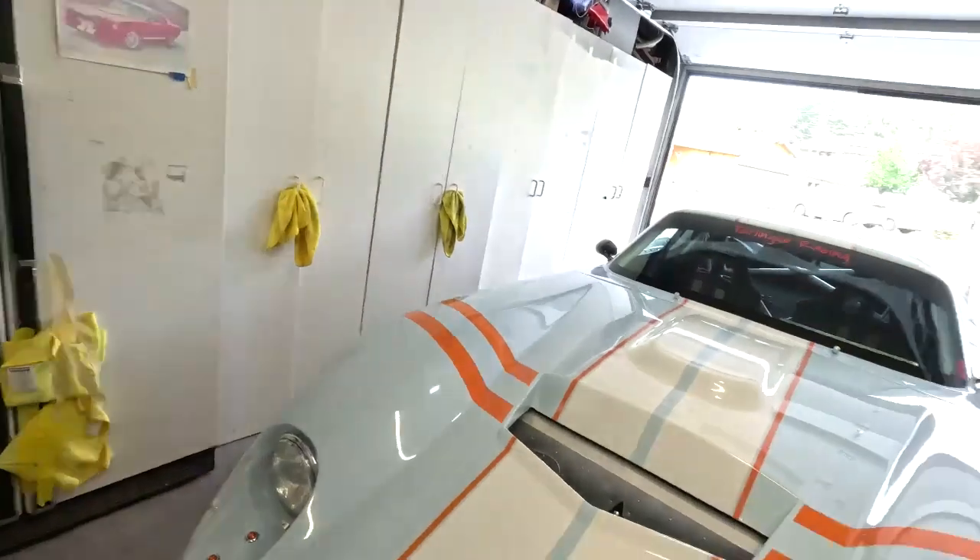I've done both drives - aero up, aero down. I'll edit these down because they're about 15-minute runs each way. What I noticed - and this is really weird - my oil temps are up 25 degrees. I'm obviously blocking a lot of air from going underneath the car and it's not getting around that oil pan. With the Coyote and no oil cooler, my oil temps were always around 150 on the highway cruising - now I'm at 175. A 25 degree difference is kind of flooring. It shows me I'm stopping a lot of airflow underneath the car - good or bad, I don't know. Let's go in, look at the data.